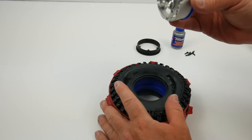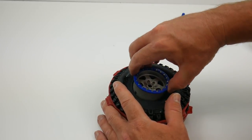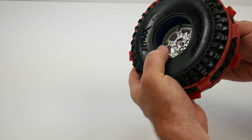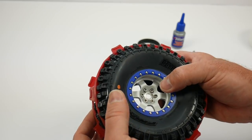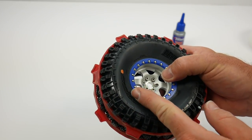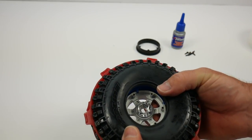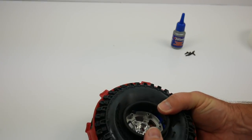Now it's time to go ahead and grab the outer portion of the wheel and line this up. You can kind of feel a grab of the bead right there, and that's a good thing. We're going to go ahead and insert this on in. These SSD wheels are a little bit particular because they have a notch that the wheels have to ride inside. Now that I have it all notched in, what's really nice about the Hyrax tires is there's a perfect bead section right here. As I start to go around, I just want to make sure that it is fully going out to the edge of the wheel and we're getting a full capture of that bead. The portion now that gets a little bit difficult is flipping this over, keeping pressure on the bottom of that wheel, and then adding the inner portion, lining up the bolt pattern, and then adding this on in.